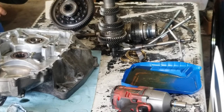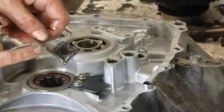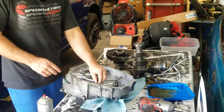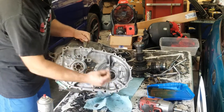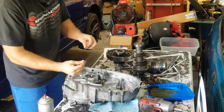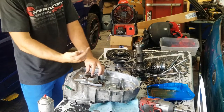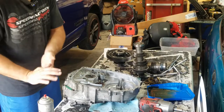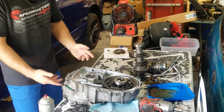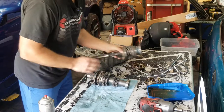Clean the case out — it's been sitting here about a week and a half and got some bugs in it. Also I'm going to clean the magnet — it has a good bit of metal on it from that gear. I've got the case cleaned out and put the magnet back in. These are the washers that go on the main shaft — one is flat and goes on the bottom, the other is concave and makes like a dome. You want the dome facing up towards the gear stack. Then we'll put our differential back in.